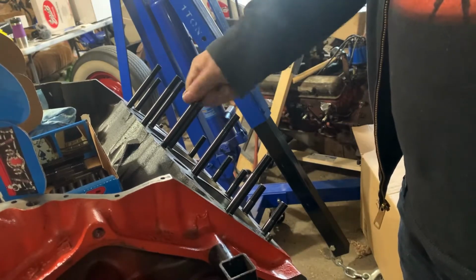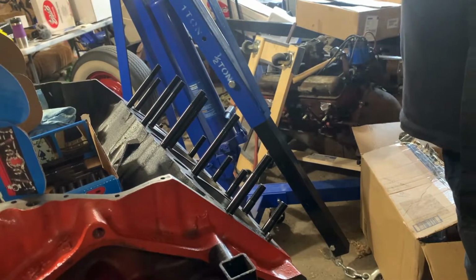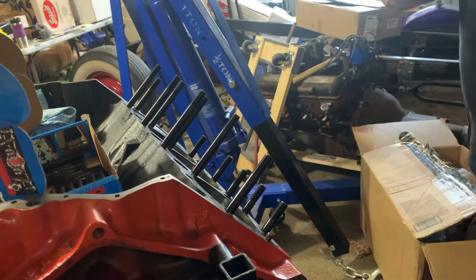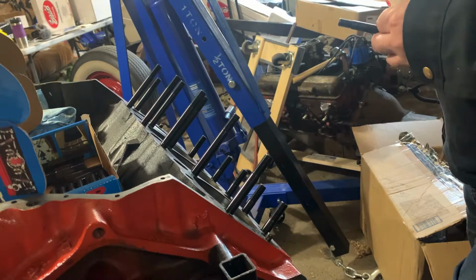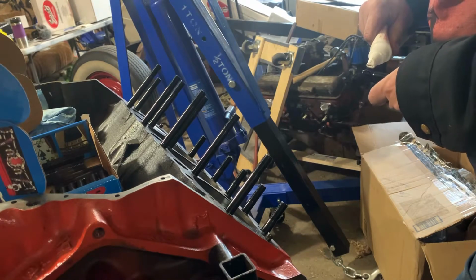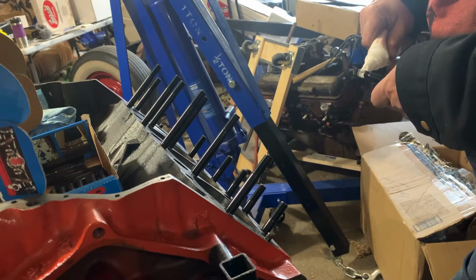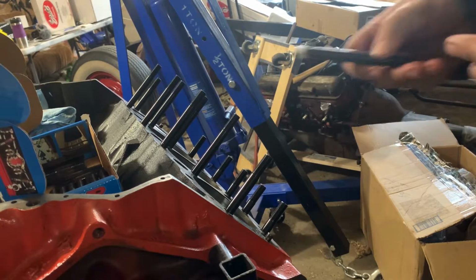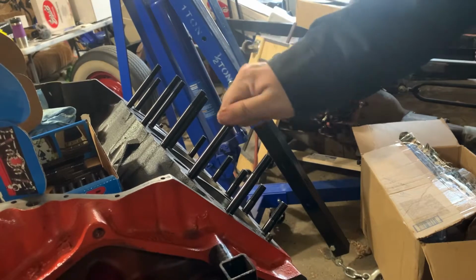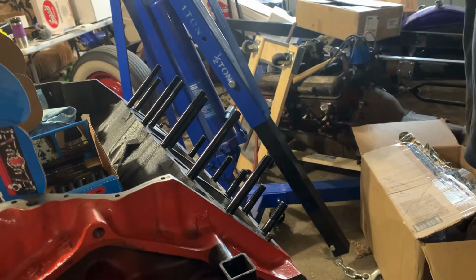and to do what it has to do effectively and be as light as possible. They don't want to put up with the heat that electronics create. Changes in your current and voltage cause havoc in electronics. If you have steady state, then it just sits there and runs like your TV. But if you have changes, things are sweeping up and down, and lots of demand on certain circuits, up and down, that creates heat. Heat is the enemy, like anything. So a box like that will tend to heat up on a street drive, stop and go traffic, up and down RPM, not just full throttle and give me all the spark I can handle.